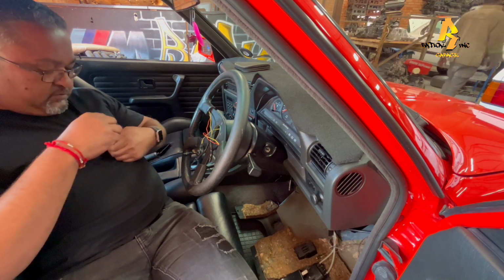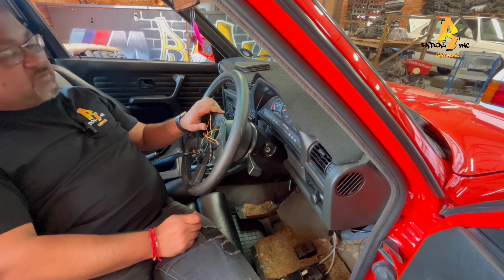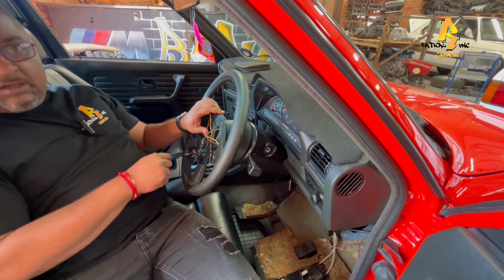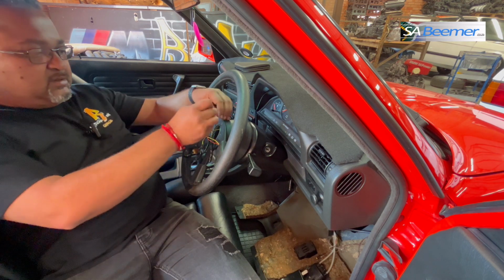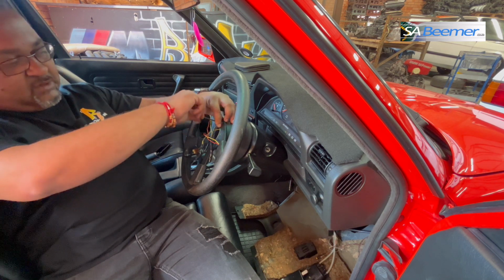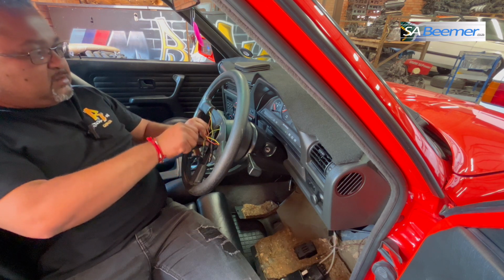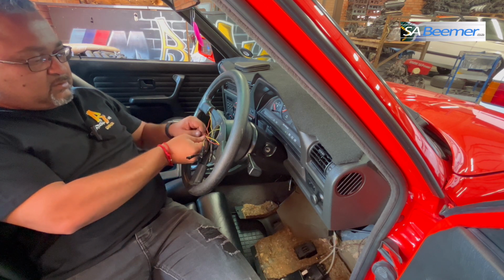Now we're going to move over and take off the steering. In a normal instance, you would use a size 23. Typical way is to use either a 4-wheel spinner, or your torque bar with an extension and a socket. Then you can remove the whole steering wheel. This is on a standard E30. This is an Alpina steering wheel, so I've chosen to remove it by the Allen keys. You've got 6 Allen keys holding it. I've already loosened the 6. It's a bit tight here.